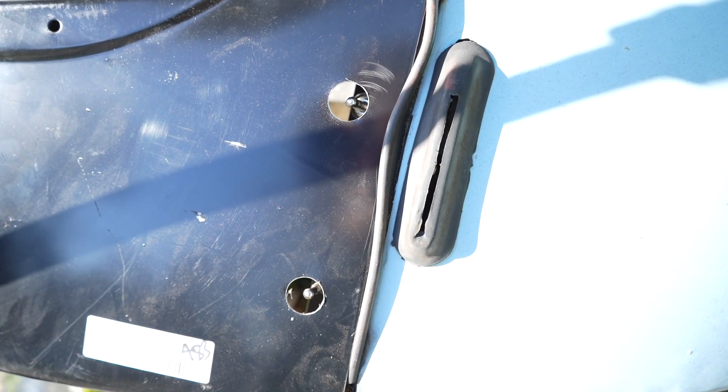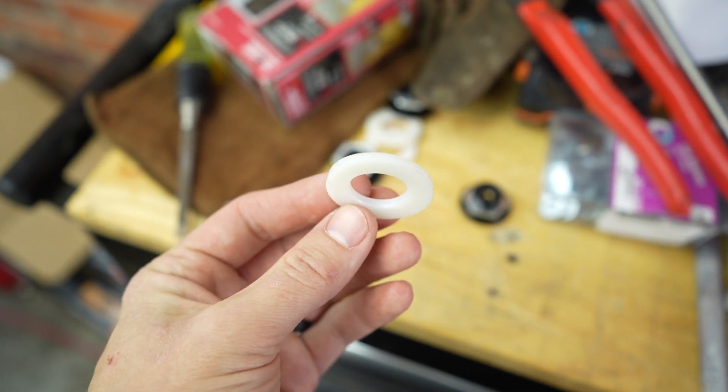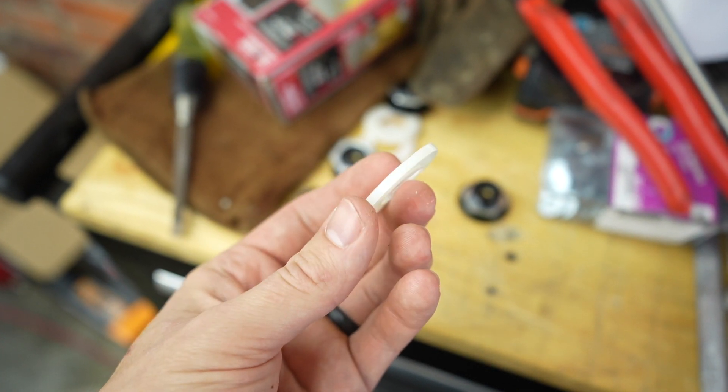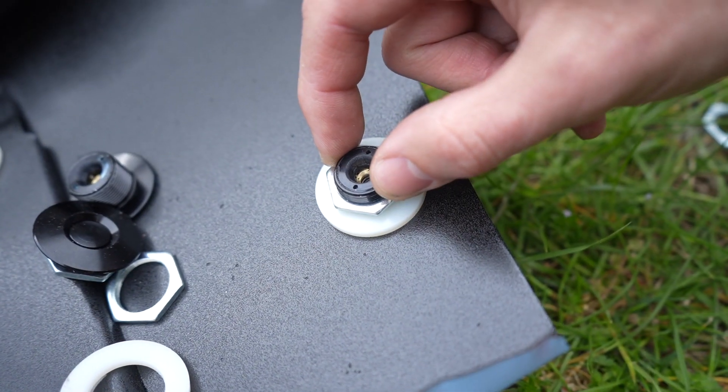Now is the time to check the fitment of your panel. Before you bolt it down, buy a nylon washer and open up the center to about three-quarters of an inch. That way, if you're bolting into a piece of sheet metal, it gives it a little bit of fender-washer-style reinforcement and lets you hold things down with a ratchet without worrying about the panel deforming. I chose nylon for corrosion resistance — I didn't want another layer of unprotected steel growing rust on the inside.